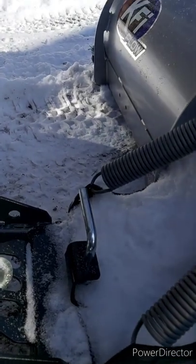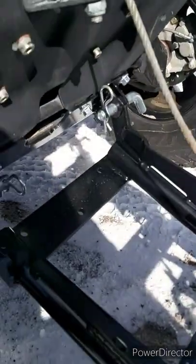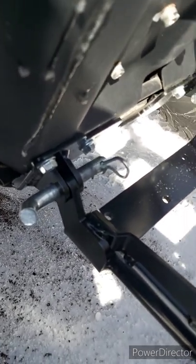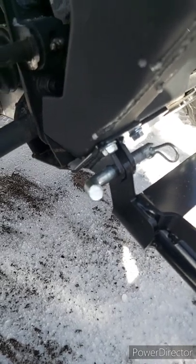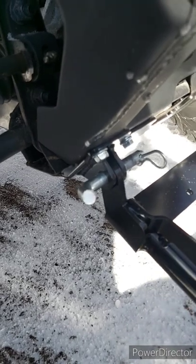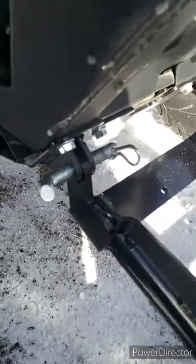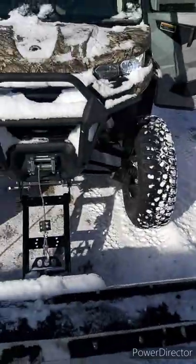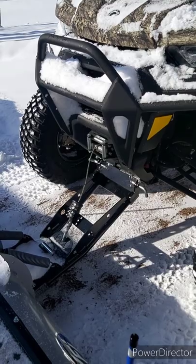It's got three pivot points. I know K&M has a few more — I think K&M has five or six. I had a K&M one for my XMR and it was good, but I didn't like how the plate had to go so far in underneath the frame — it was a lot of work to take it off and on. The K&M one had arms with a pivot that came off it and you hooked your plow onto it; it just clicked on. I found this one here is pretty simple too, and for the price point it's worth it. The issue with the K&M arms was that if you hit them on a rock in summer they would bend and you'd have to go buy a brand new plate. This one here — I don't think you can hit it off anything.